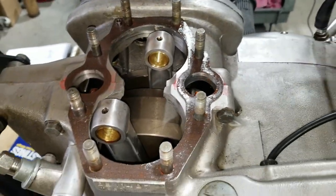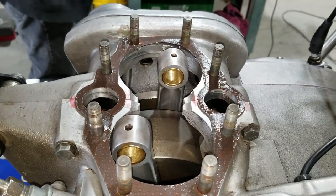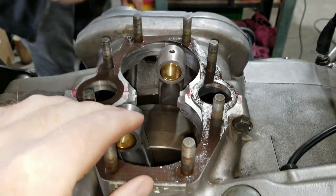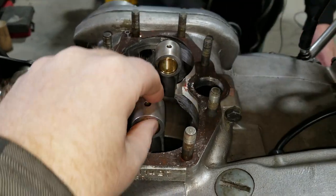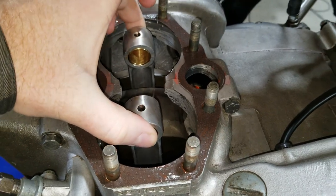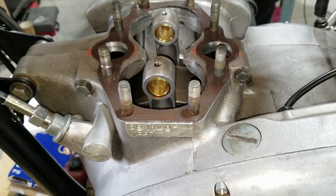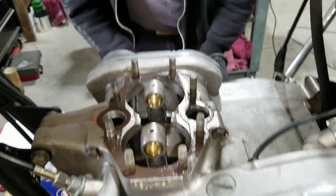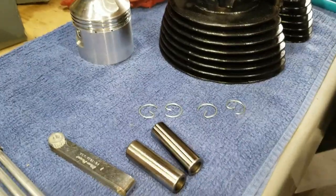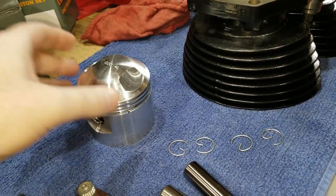All right. So here we go. We got the gasket down. We used the Loctite 510 on this stuff, and it'll work pretty good. We've used it before, so anyway, we're gonna get ready to put the pistons on now, I believe. So, you wanna bring this up to the top? Not yet. Oh, okay. We're gonna put the rings on the pistons. We gotta get the pistons prepared yet, so stay tuned here. Okay, so here we are. There's no front or back, but we're going to probably put the pistons going the same direction with each other.